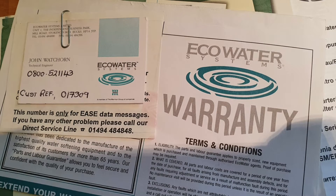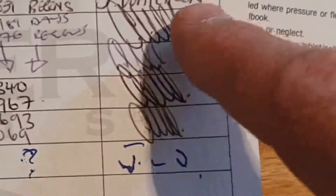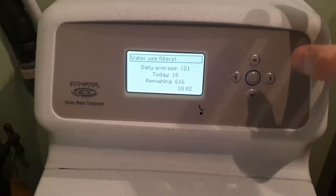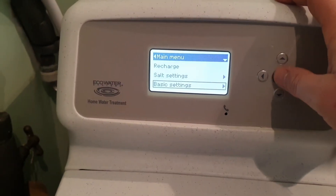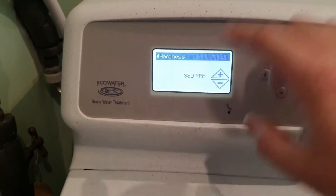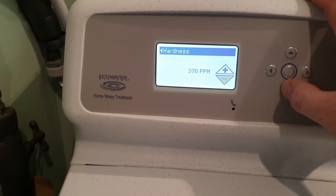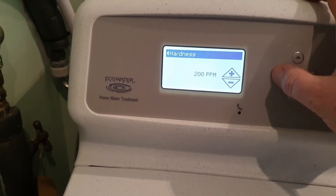This is an unfamiliar customer, so when we arrive we take out any documentation and check the history of that particular softener. Eco Water used to keep good records, so we've got a really good record of this. Zooming in from 2006 onwards, you can see it was actually me who came and did the service on the previous machine, but the machine's been changed now. First of all, check the hardness level — because they've not been getting soft water, they've exaggerated the hardness setting. It should be on 200 but it's on 380.